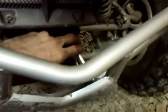Come off the bumper mount, and this bumper mount over here, bring it up, but you won't have anywhere to connect it back here. And one bad part about this, they make the coolant tank back here where you put the coolant in, and the radiator's up here, but they have the radiator cap up in here, and you see the radiator cap, but they don't have any access to it. To get access to it, you have to take the front covers off. I think that's a little stupid.